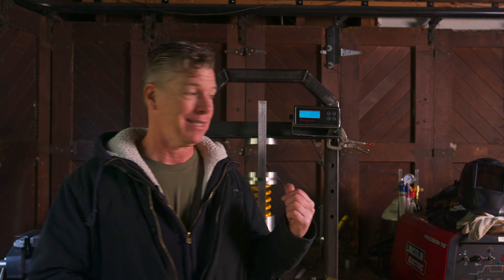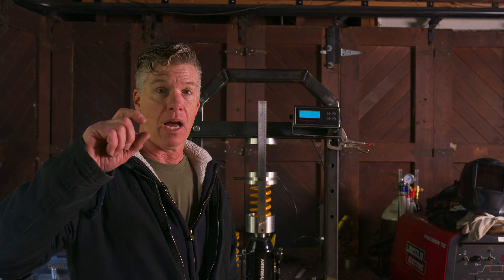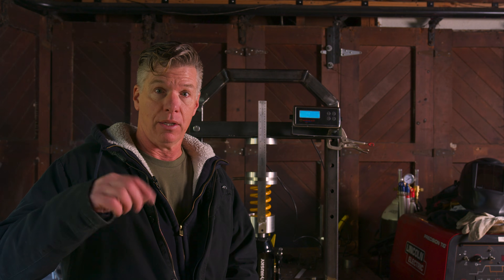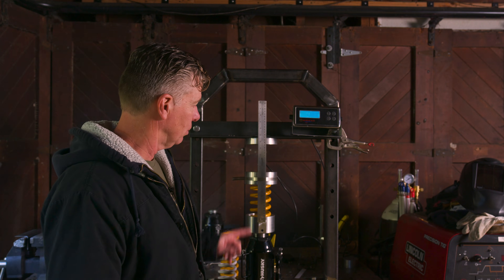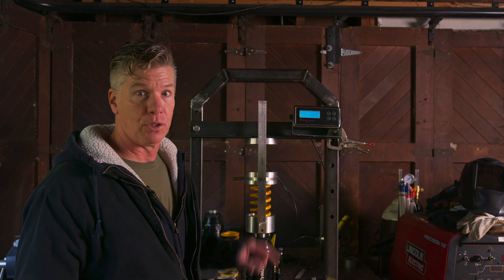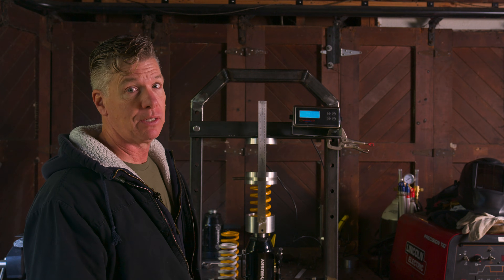I know that I can compress my shock 40 millimeters at Thunder Hill and Laguna Seca at race pace. So let's put 50 millimeters on this spring — because remember, it's got 10 millimeters of pre-installed preload, then I extend the suspension and zero out my potentiometers on the data acquisition. So 40 is really 50 because I don't count that 10 of preload. Let's see how much force there is at 50 — that'll be the peak force I experience when I'm on the track.